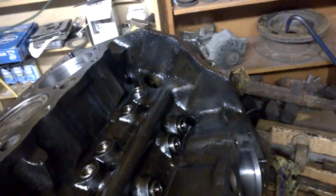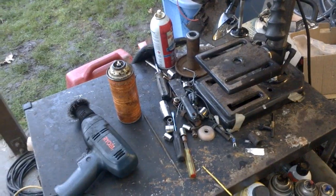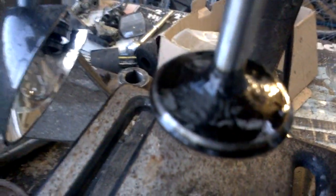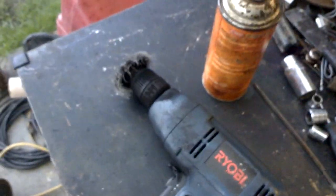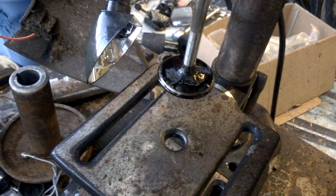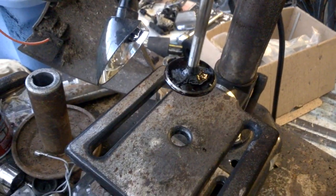Number eight — just have to use the torque wrench to set the right torque on the timing chain cam gear, and don't forget the oil pump. This is actually the best way I found for fairly rapidly removing sludgy carbon and heavy hard carbon deposits on intake valves. Basically, you use the drill with a wire brush and a drill press, with a rubber covering over the valve stem so it doesn't get scratched.